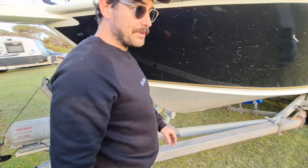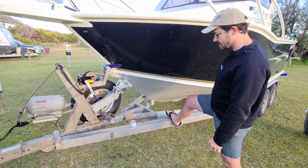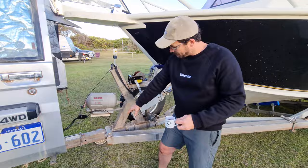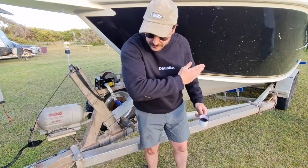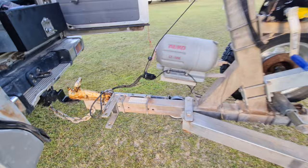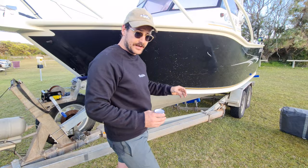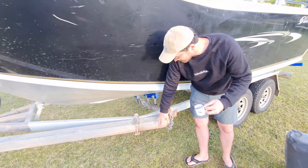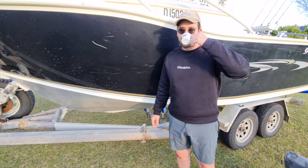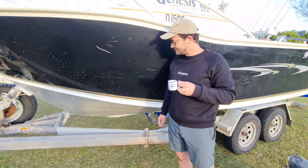You compromise that when you're bumping them off — you want your draw bar as long as it can be, which is why you get the CSD Designs extended draw bars. Basically it's just got a big pivot point here, super strong, this will swing around and then you can hook onto it with your tow ball. It has a second support, TIG welded stainless steel. Pete's design has got something extra — it's actually got a telescopic tube here, so this will extend even more and give you more length again, all on HDPE slides so any sand and grit goes in between those slides.